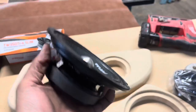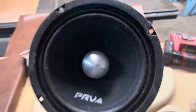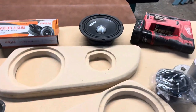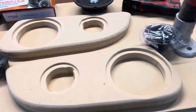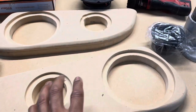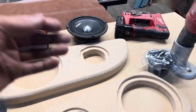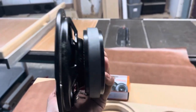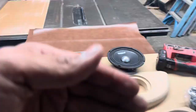Running this thing right here will have hot sauce coming out of your head — this thing is loud. That's what the customer's looking for, that's what I'm gonna give them. After I have these made, this is one and a half inches thick. By me doing one and a half inches thick, I'm able to actually pull it out far enough to where this magnet sits right about here. So there's no cutting involved inside the door and your window motors move freely.